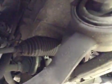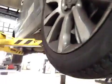Front brake discs on both sides are good. On the off side as well, lower wishbone bushes are split. Discs are good on the off side, tread depth is good on the off side, no cuts or bows in the sidewall with the off side tyre. Front brake pads are at 11mm, in the green.